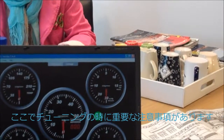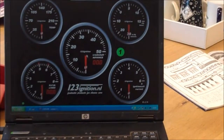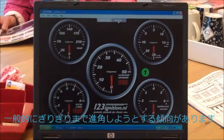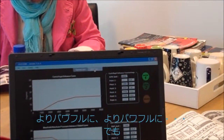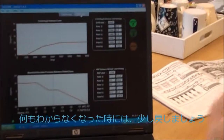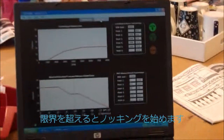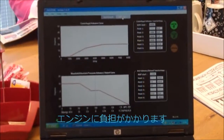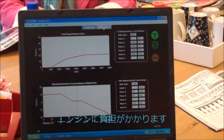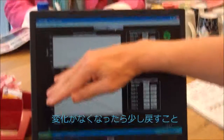So that's one method of tuning. There's always one important warning: people tend to go higher and higher with the advance curves, but you should not exaggerate that. So you go up, you see more power — wonderful. You go up, more power — wonderful. Then you go up and you don't see anything anymore — one step back. Because you can advance, advance, advance, but it doesn't bring anything. And now pinking, or pinging — knocking — you don't want that, because you will ruin your engine. So: improve, improve, improve. If you don't see improvement, one step back. That's how you go from too low upward — not the other way around.